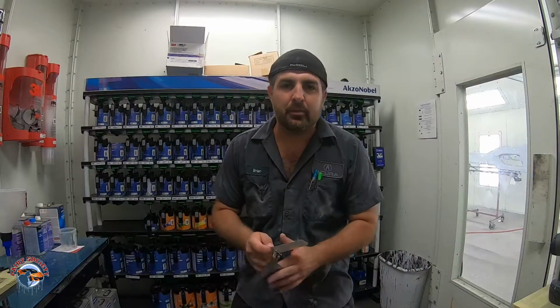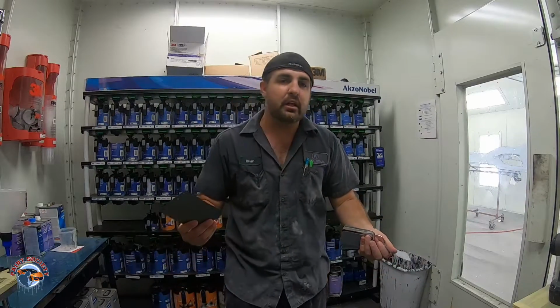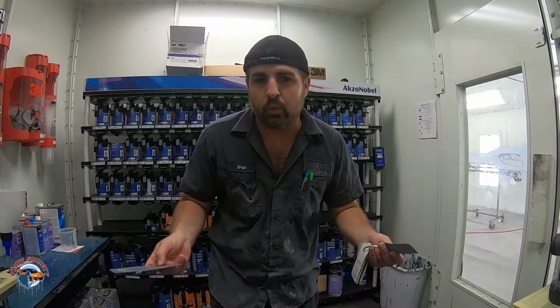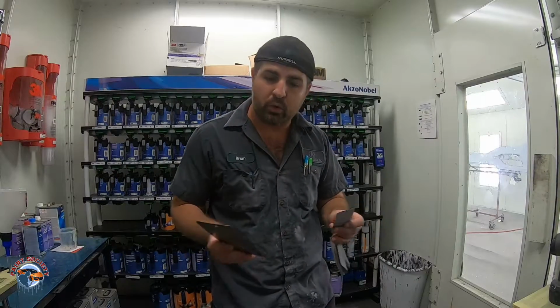And what sand piling means is putting on multiple coats to get it to cover, not allowing enough flash time, and then you start to get a dry surface, especially in a metallic finish. Now, sand piling is a little bit more evident when you are blending. But for this purpose and for any purpose other, we're gonna use a sealer. Now, the particular sealer we're gonna use, the amount is about 10 ounces. 10 ounces will cover it.